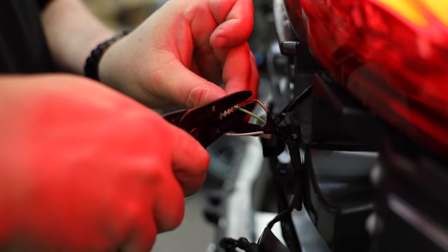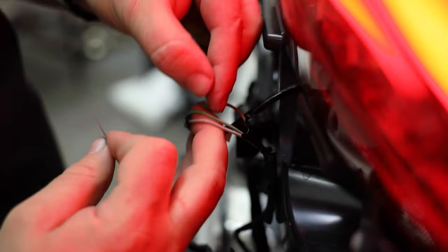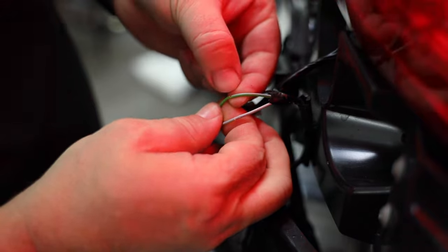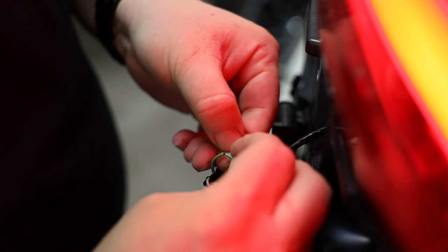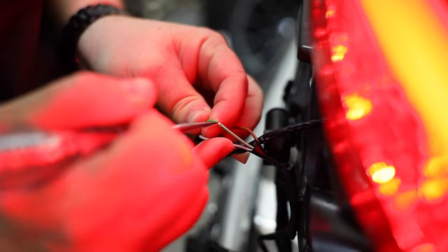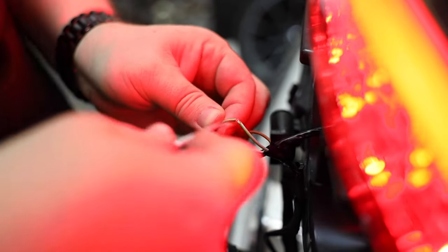Let me show you how I make my connections. I cut the wire with a razor blade — just a very minute cut — then open it up a little. I'm going to twist these wires together. I personally don't like using T-taps, even though the kit comes that way. Even the customer's video I linked — he ended up soldering because he had a loose connection. You just have to be careful how you solder. I peel the insulation back to expose the wire, then put a hole through the middle of it, feed my wires through there, and wrap them around.